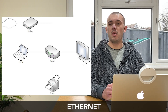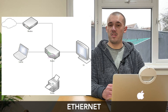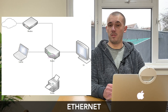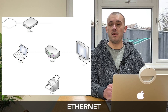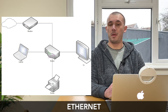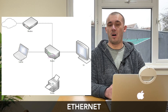Ethernet generally provides better performance than Wi-Fi and is more stable — with Wi-Fi there's a chance the signal strength can vary quite a bit or even drop completely. One thing to keep in mind if you're using an Ethernet-only layout is that a single run of Ethernet cable is designed to work up to a maximum distance of 100 meters. There are also different types of Ethernet cable which can limit network speeds: CAT6 and CAT6A cables can deliver maximum speeds of 10 gigabits per second, CAT5e can deliver 1 gigabit per second, and the older CAT5 cable is limited to just 100 megabits per second. For most people, CAT5e will be perfectly suitable. Personally I wouldn't restrict myself to an Ethernet-only layout, as Wi-Fi is simply too convenient — and you'd probably struggle to find a router without wireless capability anyway.